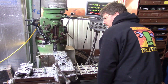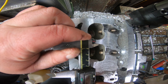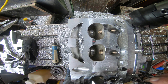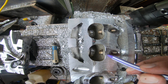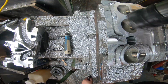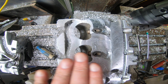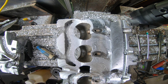33 wide. If we were to continue the D-shape we'd be about 29, but it's closer to 26. They did make the port wider to make up for this protrusion, so maybe it doesn't need to be taken out completely — just a little bit. 33.5 wide, 25.7. The bottom is actually starting to run away from the top. I don't think there are any major surprises yet, but it's still interesting.